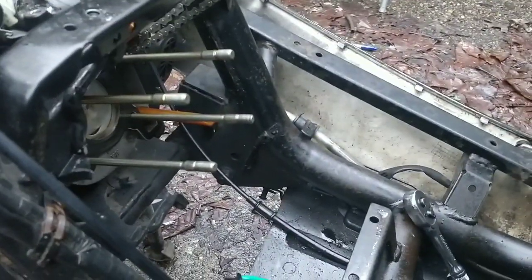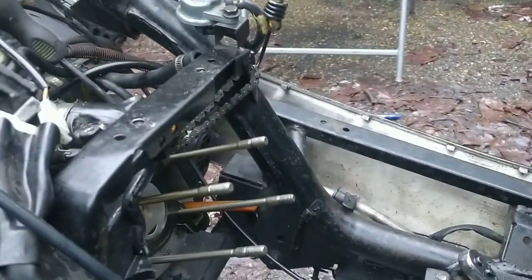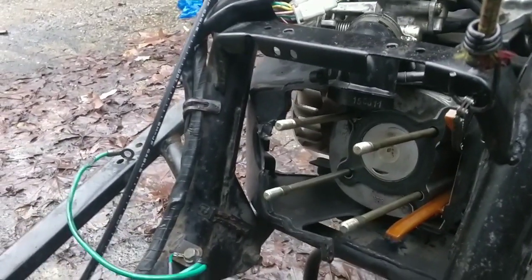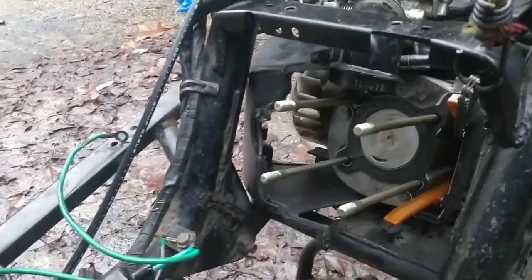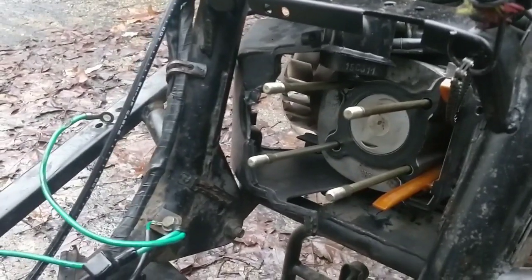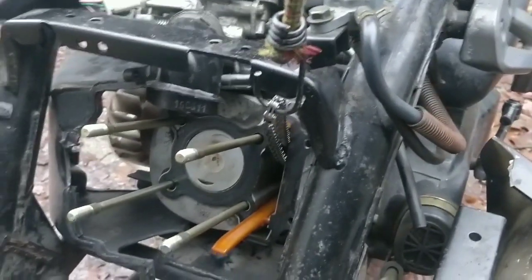We're probably nowhere near top dead centre - let's get back to top dead centre. That's top dead. Not that that matters too much at this stage. The key point now is: have I put the guide pins on the bottom end, and are they where they're meant to be? Keep the timing chain kind of fed out so it doesn't fall through - you're screwed if you drop it. Well, you could put a magnet down and pick it out, but on older bikes it could fall off the timing chain guide at the bottom. On newer bikes there's protection from that, but it's good practice to keep the chain tensioned on any vehicle.